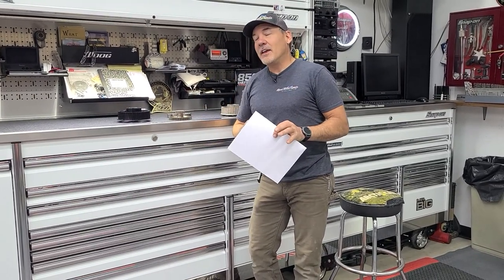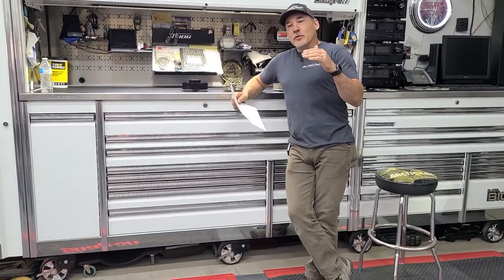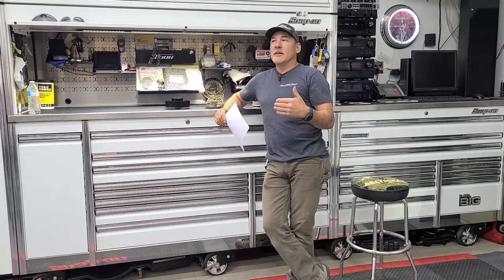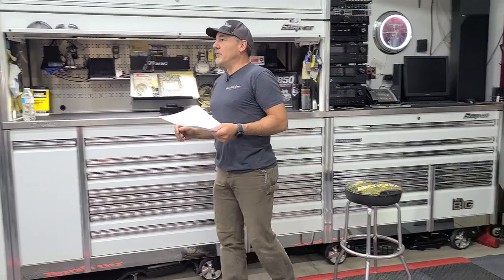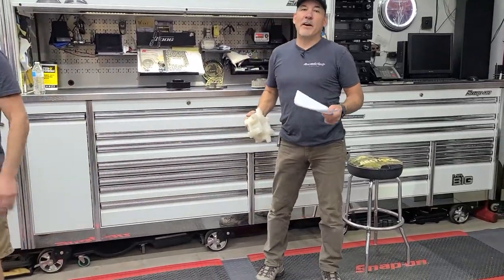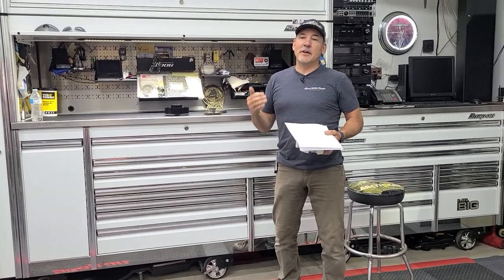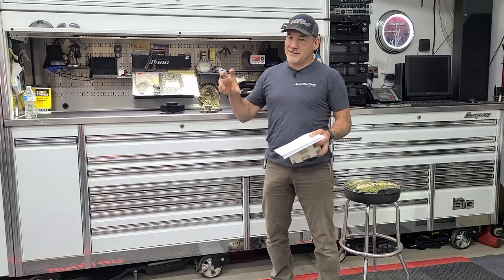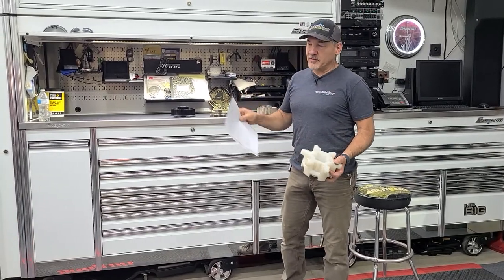In doing so, they've adjusted the number of teeth on a driver. And I'm going to have Chase grab a driver for me here and show you exactly what I'm talking about. Just to make certain that everybody understands, final drive ratio — the last plug-in in the equation is actually a reference to the original OG driver, and everything is done from that. So that would be on a nine-tooth, 2.52 driver. Everything is commonized. It's sort of the same thing that science does with the cosmological constant — it's the last thing they plug in so that all relevant data is commonized. All information is relatable across different track pitches and things like that.